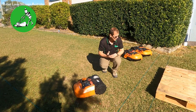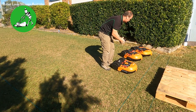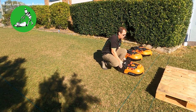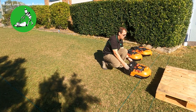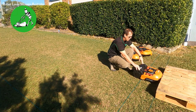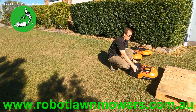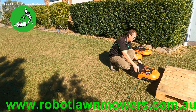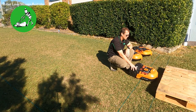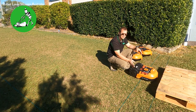But typically what really happens is the robot will go across the boundary wire, slow down as it gets to it, then speed up as it crosses over and hits your fence. It'll then reverse, try to turn left or right, not be able to work out what it should do, go forward again, and quite often just bump in and out of the fence line. Sometimes it'll get in between the two wires and follow along them and get stuck.